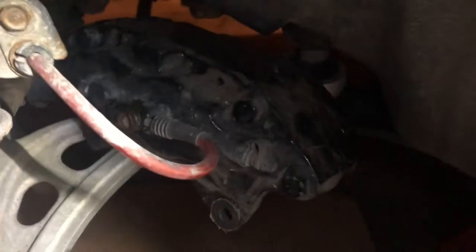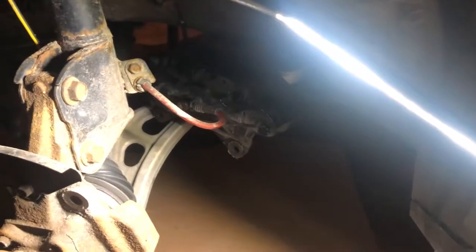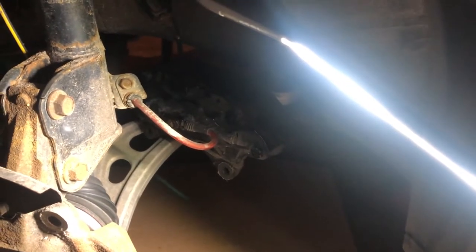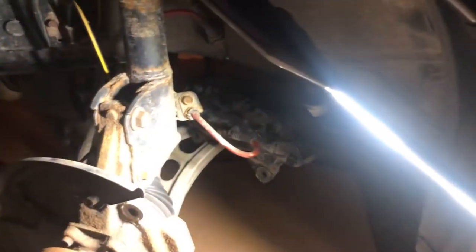Everything is off now. There is the caliper - I cracked the line, as you can see, it's kind of dripping, so we're going to swap over the other line so that it doesn't drip fluid everywhere. The old rotor is there, this is a new rotor - it came with my Brembo package. These will not work because that is 5x100 and the old ones are 5x114. So I am going to sell that with my Brembo kit - it will work if anybody wants to swap it with their 2008-up WRX. It's a full complete swap kit right there.